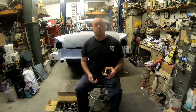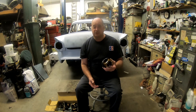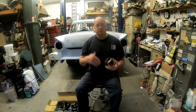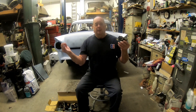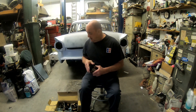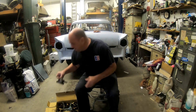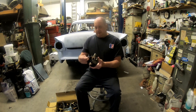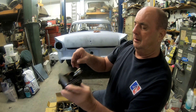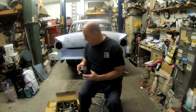We got it on the lift, pulled the oil pan, and the skirt was laying in the pan. I looked at the cylinder walls from the bottom — you can visually look at the cylinder walls — and they looked good. I said, 'I don't know how, but it survived.' So I tore it down: disassembled it, pulled the exhaust, the intake manifold, all the front of the motor off, then pulled the cylinder head off and pushed the pistons out. We found four pistons were bad — one was real bad — and there was a crack here and here, going all the way to the skirt.